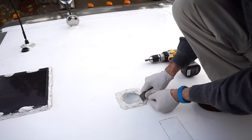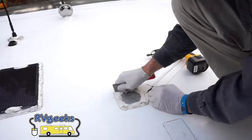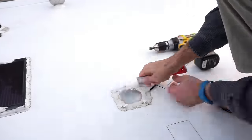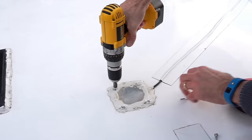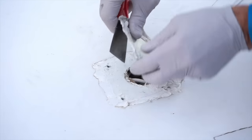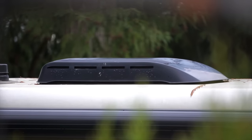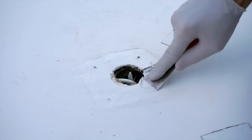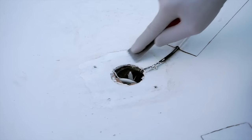As you may have seen in our video about installing our Wi-Fi Ranger, we have an access panel on our roof with a conduit leading directly into our tech cabinet. We'll remove the cover by cutting through the DICOR and removing the screws. If you don't have a conduit, you'll need to route your antenna cable another way — refrigerator roof vents are a popular way to route cables. Use the putty knife to remove as much excess DICOR as possible, being careful to avoid damaging the material if you have a rubber roof.